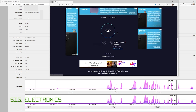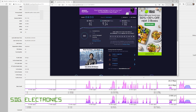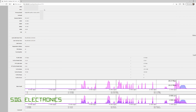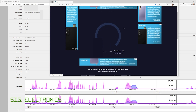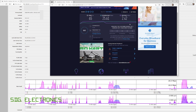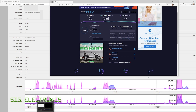Let's look at some speed tests. Running speedtest.net on band one, we get 9 Mbps down and 7 Mbps up — pretty poor speeds and I'm not fully understanding what's going on, because on my mobile phone I get significantly higher speeds. I've now disabled band one and left the others active, so it's connected to band three with a bit more bandwidth. Running the speed test again we get 25 Mbps download, though the upload dropped suddenly. I suspect this mast is a little congested, but I'm still getting much better speeds on my phone connected to the same mast, which makes me wonder if there's a hardware limitation or a configuration issue.